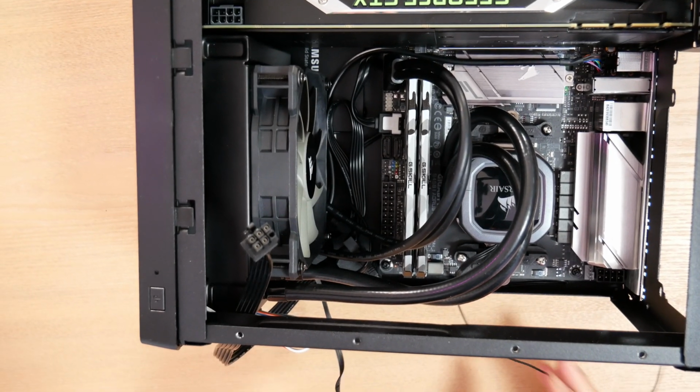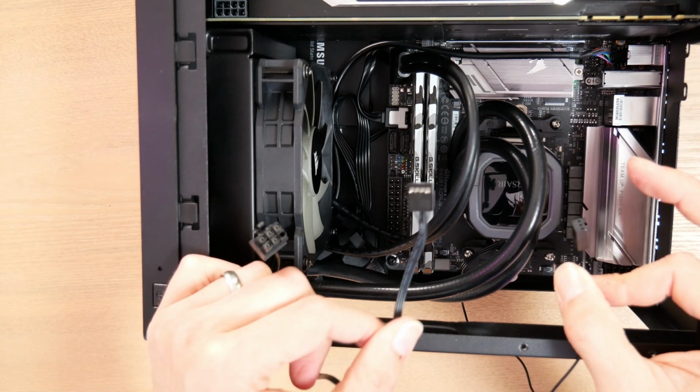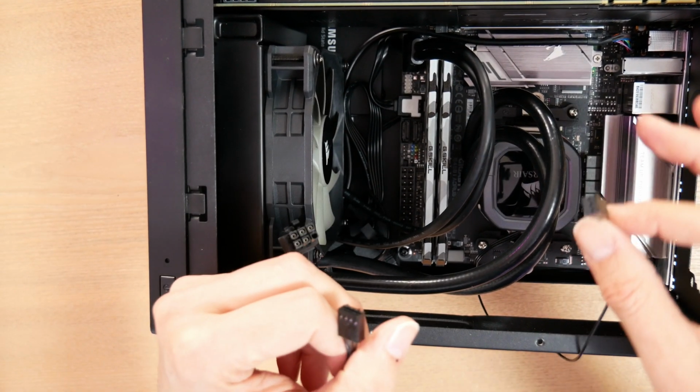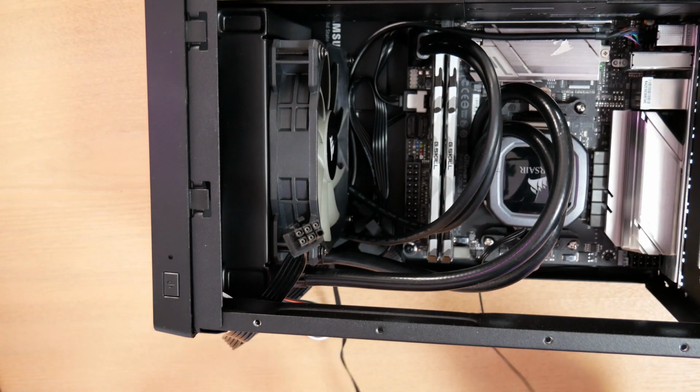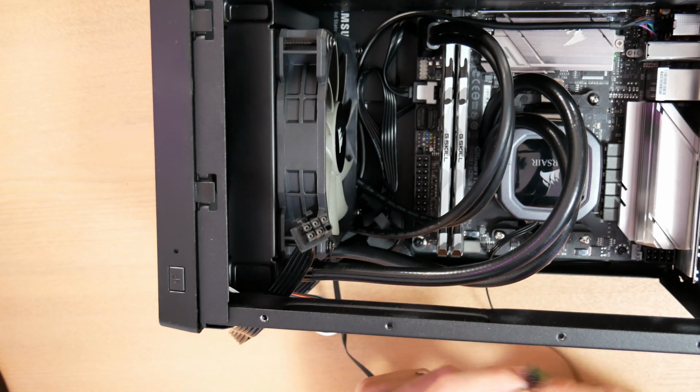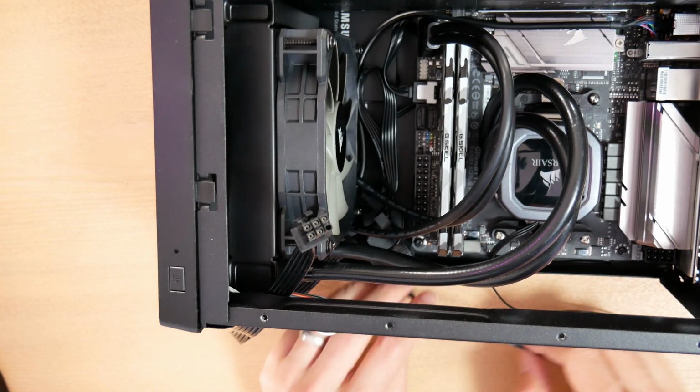All right, my cooler actually does have 2 fan connectors. One that's from the fan itself, which is a 4-pin, and one is a 3-pin for the pump. So my motherboard has something that's called CPU fan, and I'll go ahead and attach the CPU fan to that one.